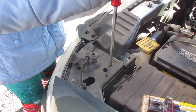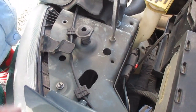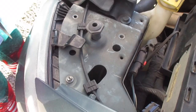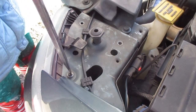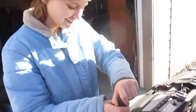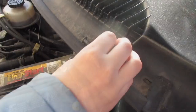To remove the front headlight on a 2001 to 2007 Chrysler Town and Country, you're going to remove the three screws right here. You can either use a socket or a flathead screwdriver. Here she is removing those — it works nicely. Just set those screws somewhere safe.